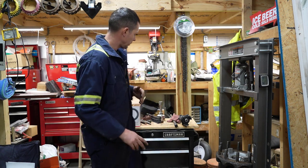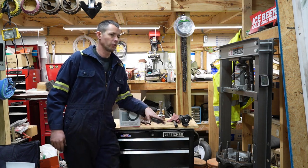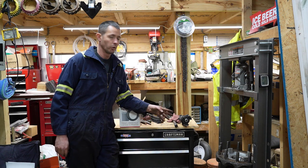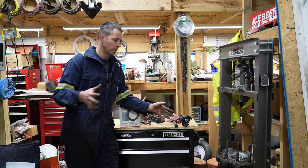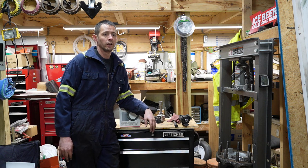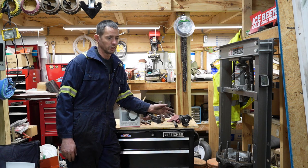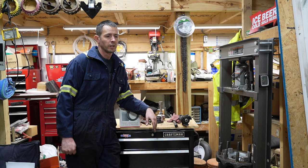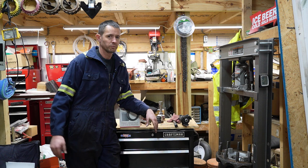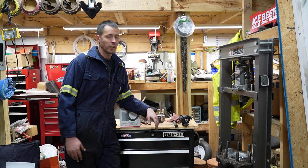But that's pretty much it for this job, guys. I usually don't do these. By the time you get into labor, you can spend several hours on this. So a lot of times I recommend to customers just putting a whole new hub on. I can get a whole brand new hub kit that has everything ready to go, and it takes me like 5 minutes to put together, versus spending a couple hours out here trying to get races out and all that, and you risk damaging the hub in some cases since it is aluminum. So a lot of times it's easier just to get a whole new hub assembly. But we thought we'd do this one because we had some people ask about doing a video on it. So there you go.